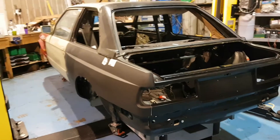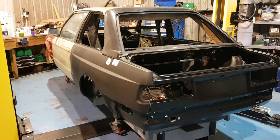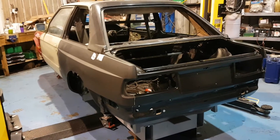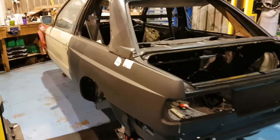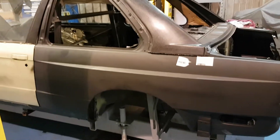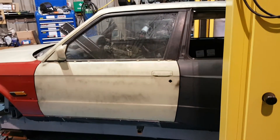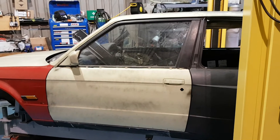The process of what is actually going to happen next: every part - the rear quarters, the back panel - will now be dowel drilled. There'll be a nut and bolt which will hold the rear quarters on to the car, drilled in the position they're in now. Then I will remove the rear quarters, the back panel, and remove the outer sill skins completely and replace the outer sill skins. I had to do all this work purely because I need to know that the car was straight, the panels would line up, and I can get the measurements off the door to the sill correct when I fit the new sill.